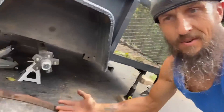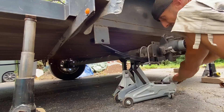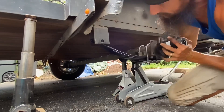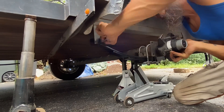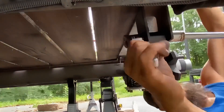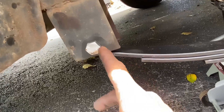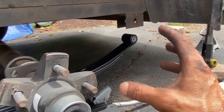Alright, so we got it off. I did miss some footage here — the first step is to reattach the leaf spring to the axle using those U-bolts and the four nuts. The jack helps you maneuver this piece. This one gets tightened up, while these stay where they can move a little bit — they need that movement.